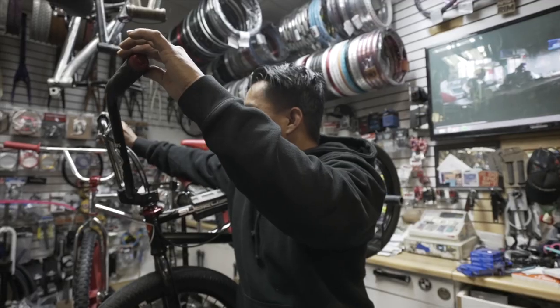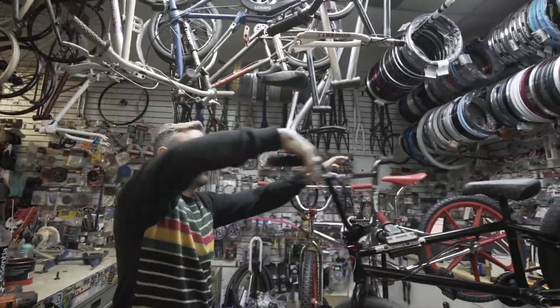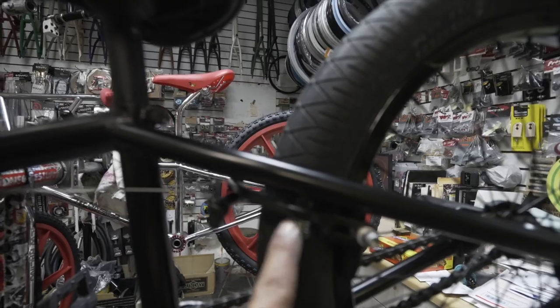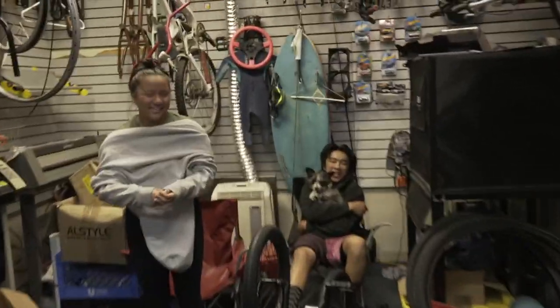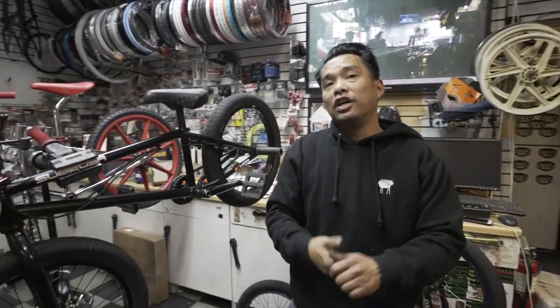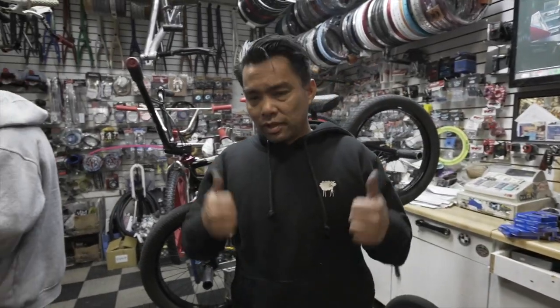Tire's centered. The pull feels good. When you brought it in earlier it was pretty rough. I know you guys can't feel it — you're going to have to just trust us. It's a lot smoother now, very smooth. These are all the old parts that we used. All I did was open it up — the brake post where I cleaned it up makes a dramatic difference. Lube up all the cables. That's all I did: just clean up and lube. There were no new parts. How we sand down that post is one of the key things, because after a while water gets in and it builds up as gunk and makes it seize up. If this video does good, I'm going to try to do this on an old school bike, which is a little more challenging. Subscribe and like this thing — thank you.